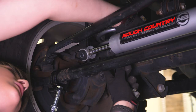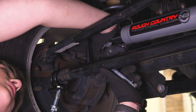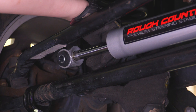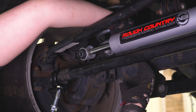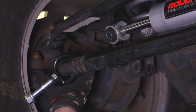This is going to be a little difficult to see because of the steering stabilizer, but we are going to re-bolt up our track bar. I have someone in the driver's seat — how you can get this lined up is to have the Jeep on its own weight and turn the wheel back and forth, which will move the axle back and forth to get it lined up. Once it looks lined up, grab the factory bolt and put that through. Now that the bolt is in, secure down the flag nut, then tighten down with a 21-millimeter socket, using an extension to clear the drag link. The last step is to secure the steering stabilizer, but most of you won't have this, so I'll do that off-camera.